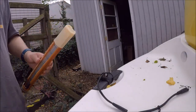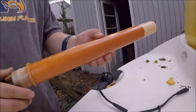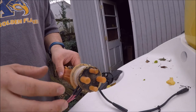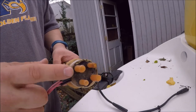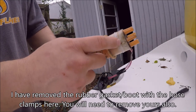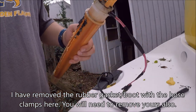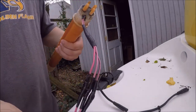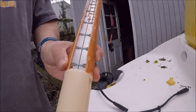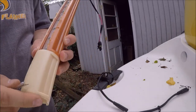After you finish testing the gauge, the next problem is probably going to be this — this is your fuel sending unit, or fuel baffle as some people call it. Here's where your hoses go in. As you can see, I've numbered them: one, two, three, and four where the hoses go. These are the wires that connect to the wiring harness. Yours isn't going to have the side cut off like mine because I had to do that to perform the fix.